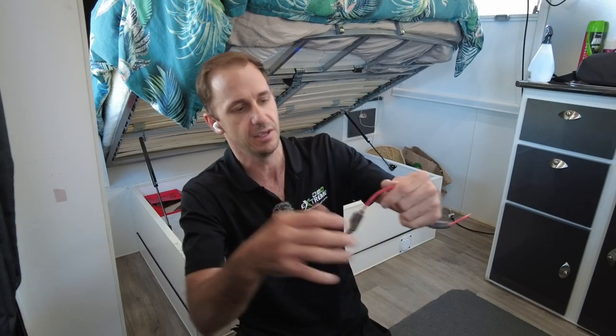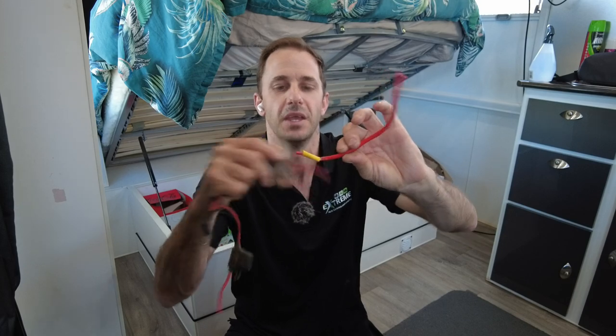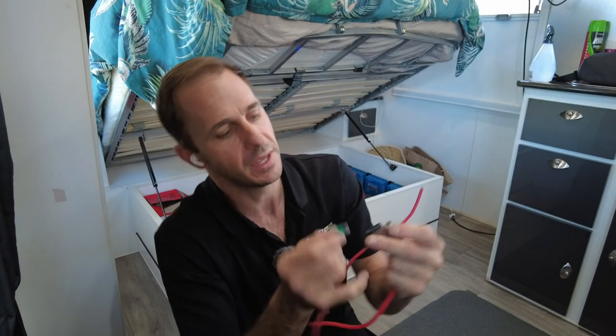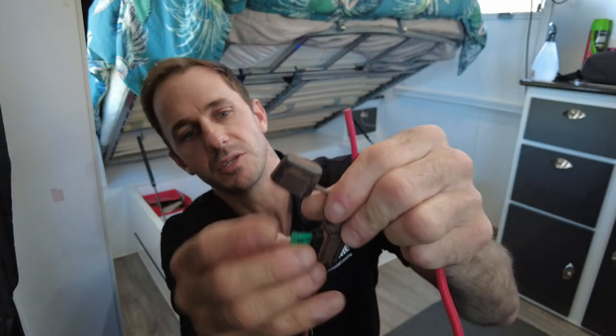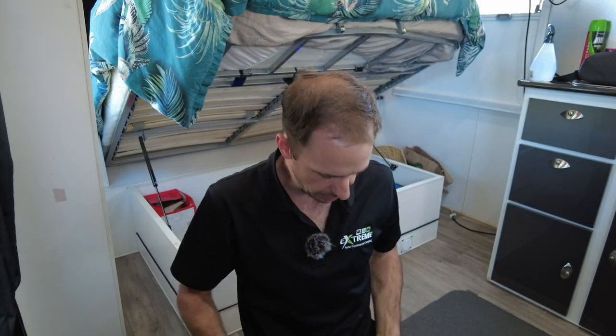This cable they call 6mm auto, but it's actually only about 4.8mm square. When you run 8 B&S cable into one of these blade fuses, the contact area is barely there — only just. This essentially becomes the bottleneck. It's starting to melt — that's the 30-amp fuse. It's like female and male spade terminals with a minimal point of contact. Because it's loose, it's going to create heat if you start pushing big current through it. It's a bottleneck, and as the fuse becomes the weakest link in the line, it should pop before the cable gets hot and goes on fire.